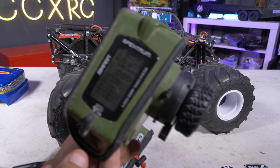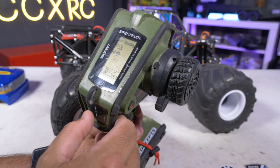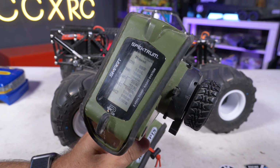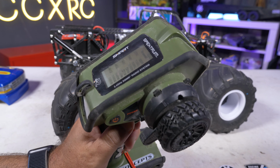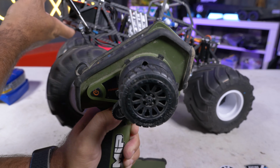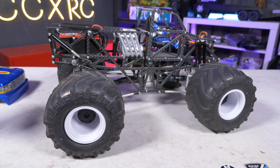So basically, just go into your settings here and go back. I did not hit into it right. And we choose travel, and that's where we set our, oh, we have it at 50% on our auxiliary. So you just hit that, and when you're pushing on this forward, you can then up or down the amount. So we have it set at 50%, which is enough to really whip the truck around. However, it is not doing it right now because that servo horn is just slipping in there.